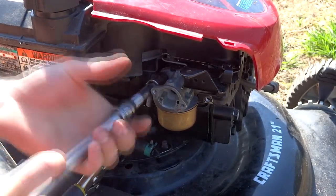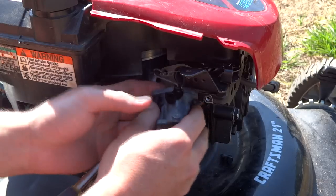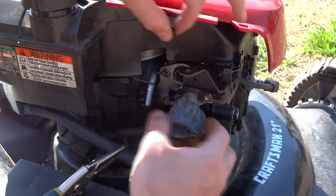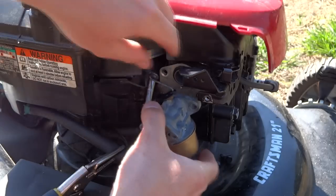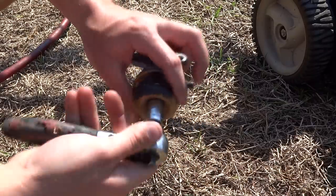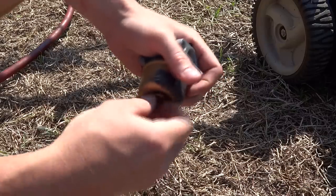We're going to go ahead and take this off, and we've got one more on the other side. Before we go yanking this off, you want to take this spring off right here in the top right corner. You want to twist your carburetor upside down to take off the throttle, because if you yank it, it has a little bend in it. Before taking this carburetor inside, I suggest getting a half inch socket and taking the bottom nut off — it's actually the drain bolt — just so we can get the gas out.